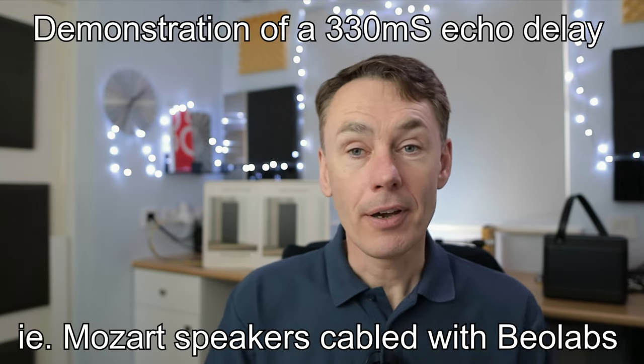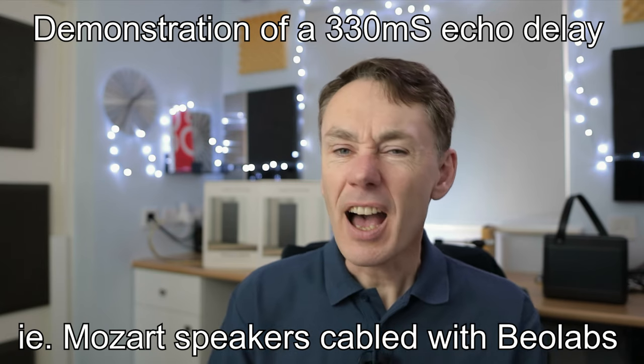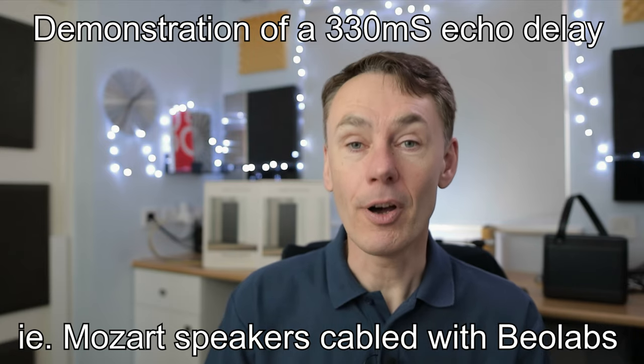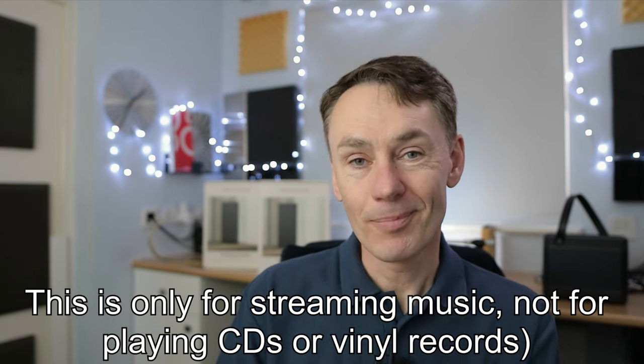It's also worth noting that the audio delay within the speakers does prevent them from being used alongside traditional B&O speakers — such as B&O 8000 or similar — via direct cables. You'd actually get an echo: you would hear the sound through the B&O speaker first, and one-third of a second later you would hear the same sound through the new smart speaker. That's a really annoying echo and isn't viable. However, there are ways around this — AirPlay 2 is a good solution for Apple users. What you can do is use any music streamer that supports AirPlay 2, such as later generations of AirPort Express, Bang & Olufsen's Essence or Core, or Sonos Connect, and use this to stream your music to the music system and the B&O speakers, and simultaneously stream to the smart speakers, ensuring everything is timed together.